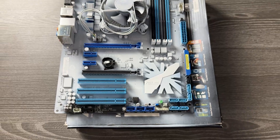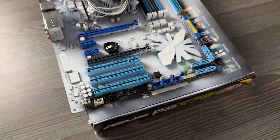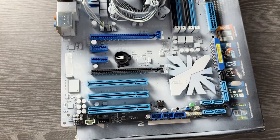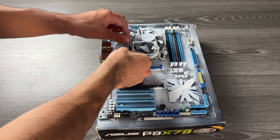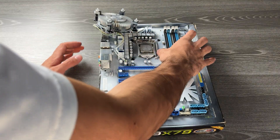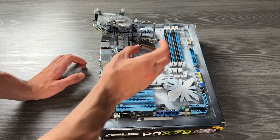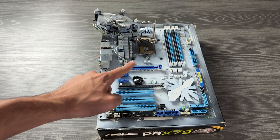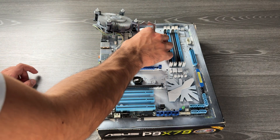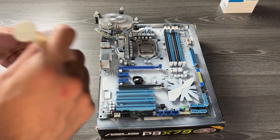It's important that you remove your CMOS battery — this is very important. The socket is also tricky. The socket covers you get when a motherboard is brand new — I wouldn't trust them. I think the best approach is to put a CPU in there, and I recommend putting a stock cooler on top, because even if you want to swap coolers later, the stock cooler is going to protect your socket. After painting, I showed the socket perfectly clean, and that's key.